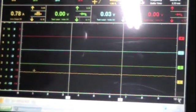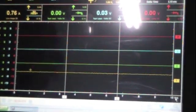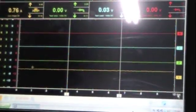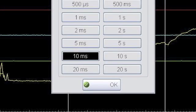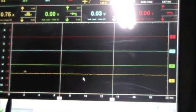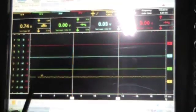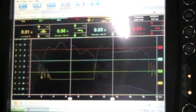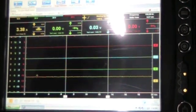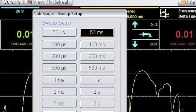That's the fuel pump. As you know, the fuel pump is going to run for a few seconds — if you don't start the vehicle, it's going to turn off. That was a little bit hard to see. If we want to see it a little better, we can go up and change our sweep. We're at 10 milliseconds; let's broaden it out to 20 milliseconds. Now you see we're reading from zero to 20 milliseconds, still on low amp current, 20 amps. Let's turn the key on again.